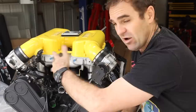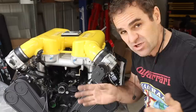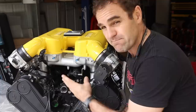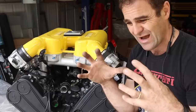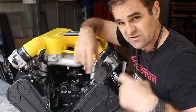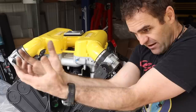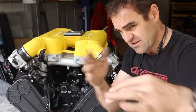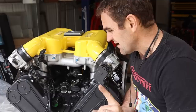You get the benefit of both long and short runners - long runners generally give better bottom-end torque and short runners are much better for high RPM power. This has the best of both worlds. Lots of cars have some version of this - the Boxster's Audi engine also has a version of this. The issue I have is that in the Ferrari it's actuated by vacuum. These two vacuum ports go to a vacuum tank, and when the ECU decides it's the right RPM level it switches open solenoids that pull the actuator arm, opens the butterflies, and you get that high RPM power.